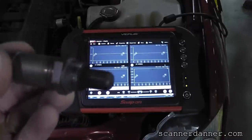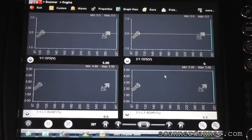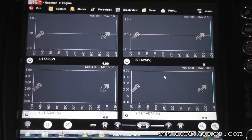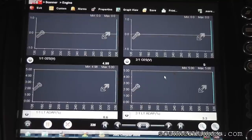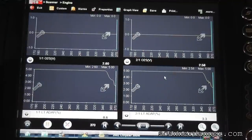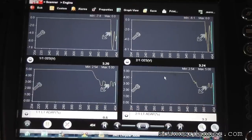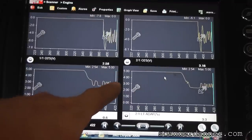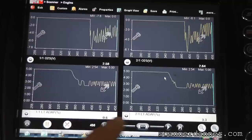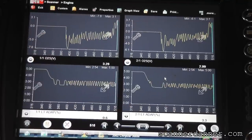The end of it is different, but that really doesn't tell you everything. I'm going to start the car and let you see it - this is our first shot with this new O2 sensor, which is our bank two sensor one, the one we replaced. The five-volt we're looking at is a bias voltage on the signal circuit. These bias voltage numbers should drop pretty quickly. Long term is down here, short term is up top - right away we see these O2s dropping down, which confirms good heater circuit operation. This is the one we replaced and it's already active - that was very fast.